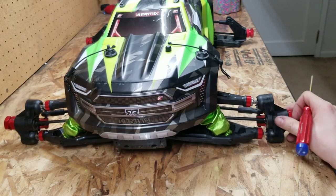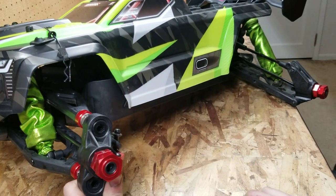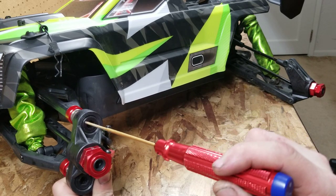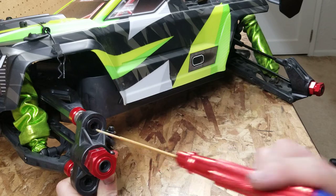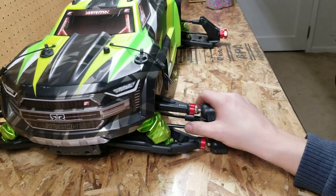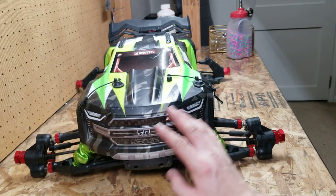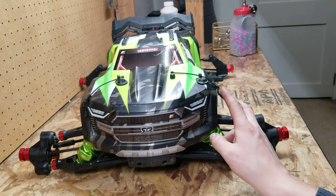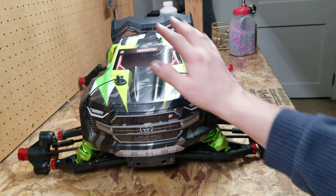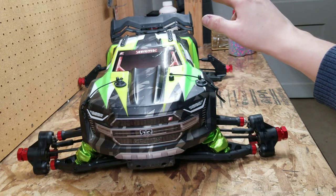There's a plastic nut on this side — it's an 8mm allen. The inside hollow ball end is a 6mm. I really recommend having an impact driver to drive those in, especially on new RPM arms, which are nylon plastic instead of the traditional composite plastic like the factory ones. The Kraton 8S has an awesome body — it looks like a truggy to me, like a truggy basher. The shape of the body is badass and the wing is cool.